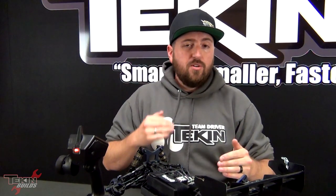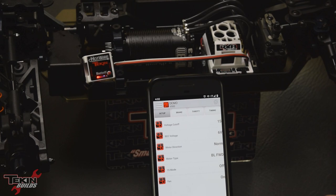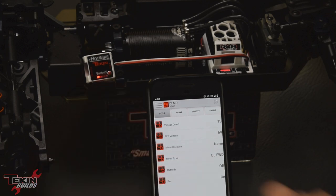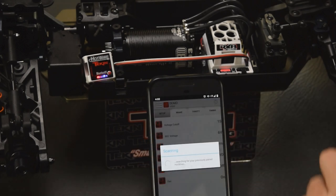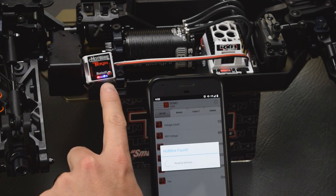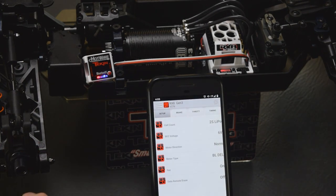If there are any codes or it's flashing no radio signal, it might not connect because it's not actively looking for that connection request. So let's turn our car on. We want to see the red indicator light come on the Bluetooth Hotwire — that means it's getting power from our RX-8 Gen 3. Now we've got our app open on the Android phone. I already have this bound to my car — it's a really easy process and you only have to do it once per Hotwire unless you switch phones or reinstall the app. It'll forever connect after that. We're going to press the connect/reconnect button, it'll scan, and once it finds our Hotwire the blue Bluetooth light will be lit. It says Hotwire found — now it's going to read our settings, and once our setup tab comes up we can throw in a base tune.